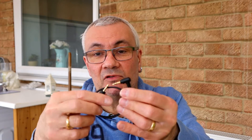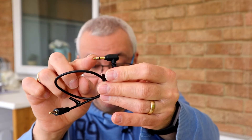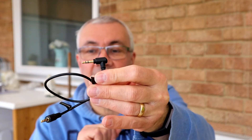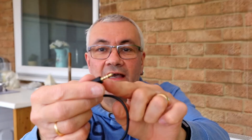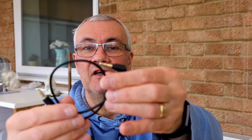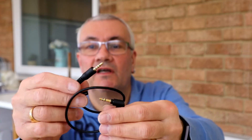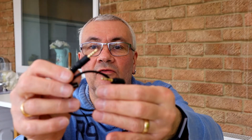But because we're plugging into a smartphone, we can't use that one because it won't work. What we have to use is one of these. On one end we have TRS, but the end that you plug into your phone is TRRS — tip ring ring sleeve — whereas the standard lead is tip ring sleeve. So the TRS end plugs into your microphone, and the TRRS end goes into your phone.